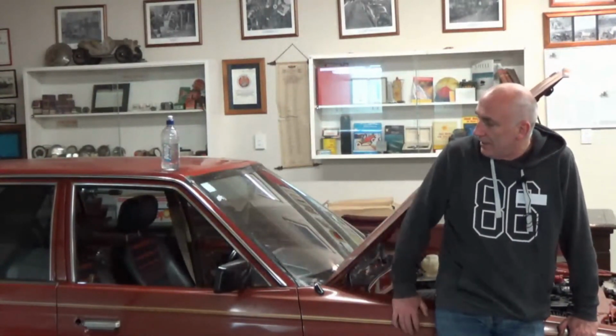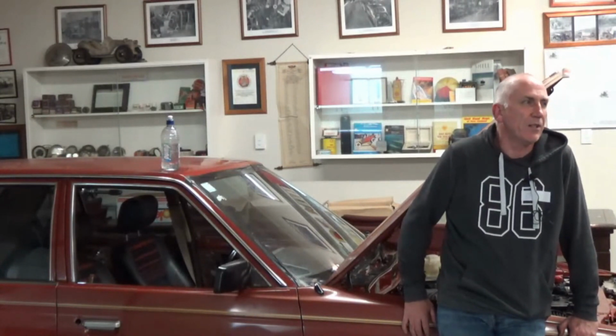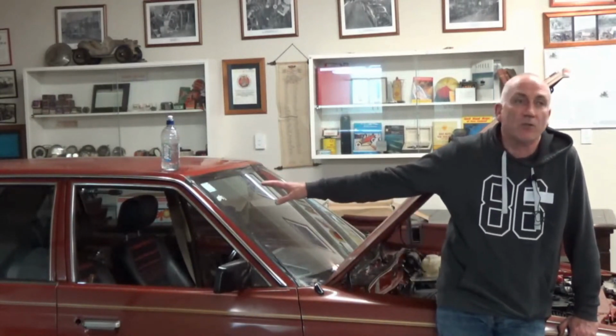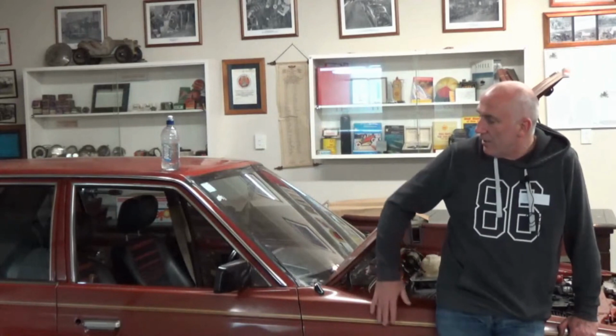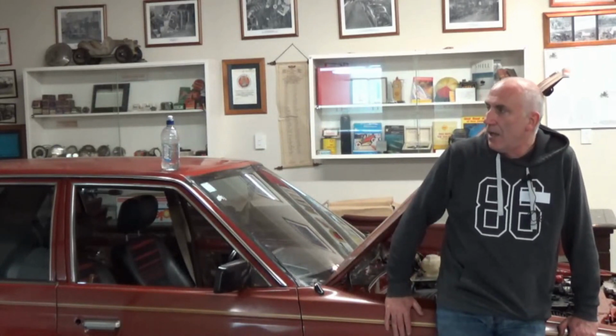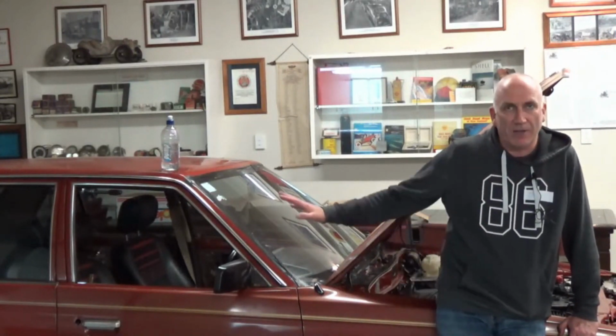The rear axle in it is the heavy-duty Celica rear axle, which is quite rare. I got this one out of the States. It's a 7.5 inch. I could probably get away with a 6.7 inch, which is what these things come with stock, albeit with drums. And the ratio these come with isn't all that conducive to this package. But I feel that because the Altezza runs the 7.5 inch rear end, and I can get one, it made a lot of sense.